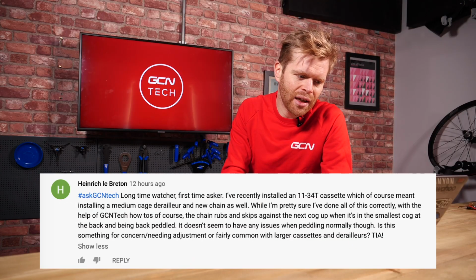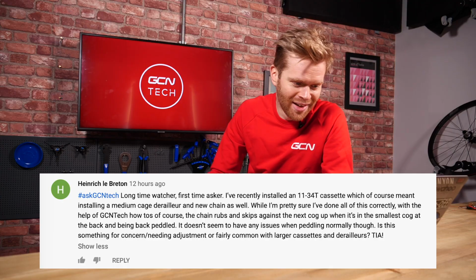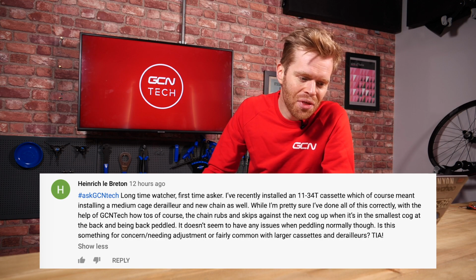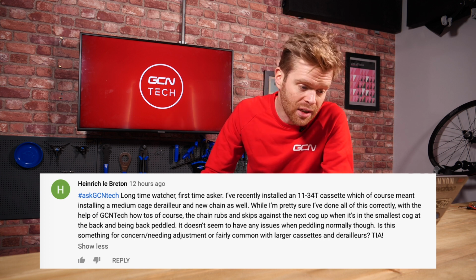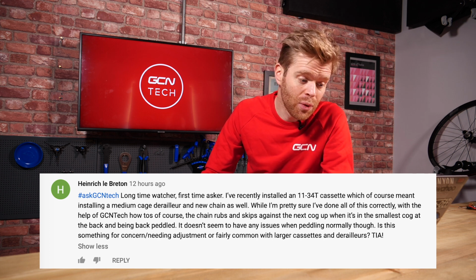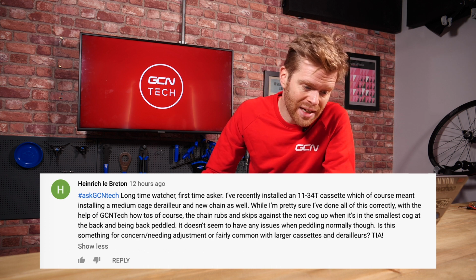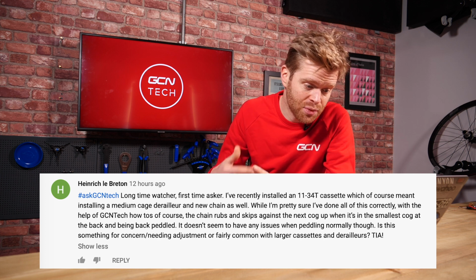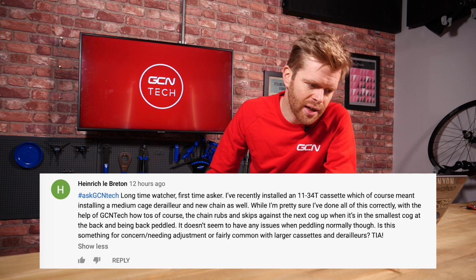Next question is from Heinrich Le Breton, who says, long time watcher, first time asker. Nice. I've recently installed an 11-34 tooth cassette, which of course meant installing a medium cage derailleur and a new chain as well. While I'm pretty sure I've done all of this correctly with the help of GCN Tech content, the chain is rubbing and skipping on the next cog up when it's in the smallest cog at the back, and when backpedaling as well. It doesn't seem to have any issues when pedaling normally though. Is this something for concern? Do I need to adjust it, or is it fairly common with larger cassettes and derailleurs? TIA, which either stands for thanks in advance or this is Africa.